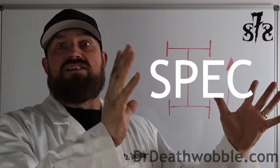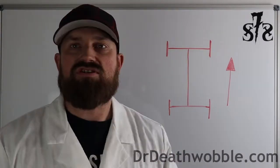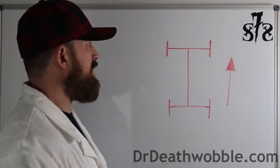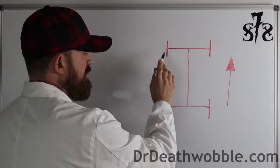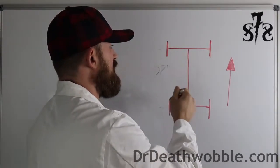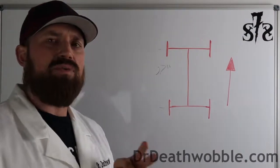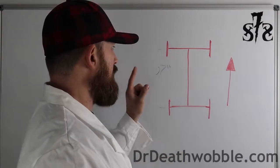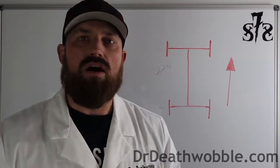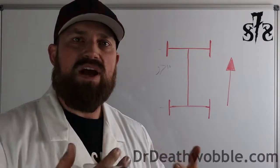The next big one you're going to hear all the time is 'spec,' which is short for specification. When the vehicle is designed, the engineers are going to have a specification for what they want to see for the alignment quality of the vehicle. For example, if we have all four wheels and spec is 107 and a quarter to 107 and three quarters inches on wheelbase, that's a half-inch tolerance. If one side is shorter, we have to adjust the arms to even it up. So when we say 'spec,' that's specification — a guideline so that if the vehicle is within spec, it really should drive well.